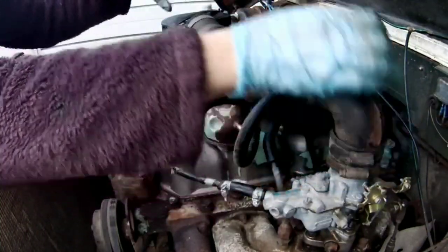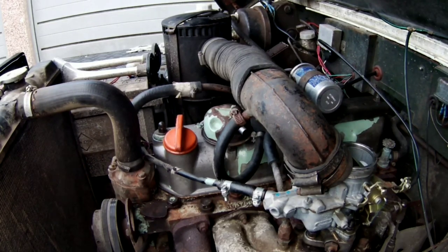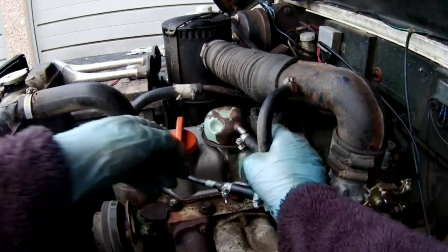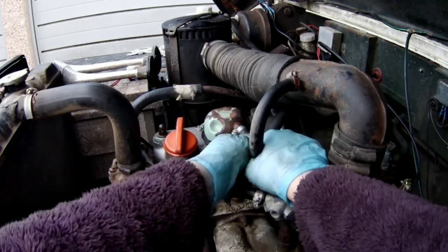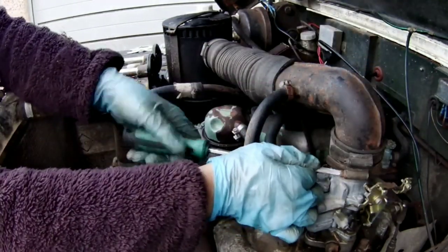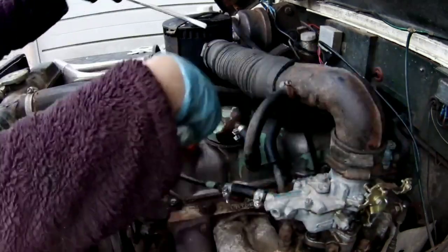The final piece of the puzzle: the long air filter pipe. I've had a K&N type filter on the carburettor before but it does make it a bit more noisy in the cab area. The standard fit air filter is a lot better when you're fording because of the high level of the air intake — so less likely to suck any water into the carburettor.